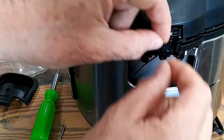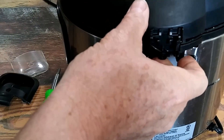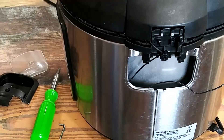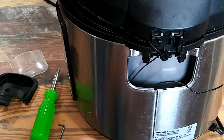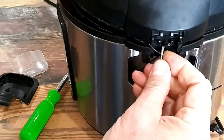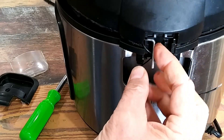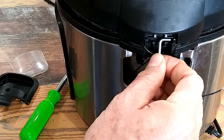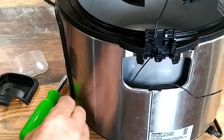Because the wire is so short, I can't get in there to strip the insulation off to solder it back together. So I had to take the lid off by removing these two hinge pins from the side — one on each side — and then the lid just comes off when you turn it over.